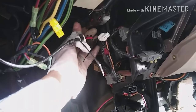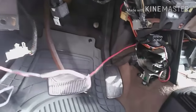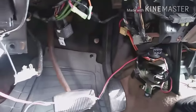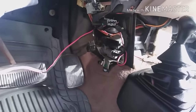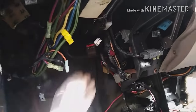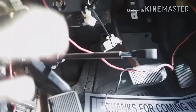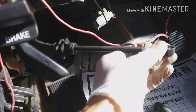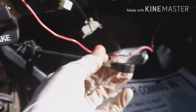I've probably done 10 to 15 heater cores so I know the procedure. You have to follow the shifter cable and unplug it from behind, because if you leave it plugged it's going to crack. I'll show you when I take it out. So this is the shifter cable I was talking about.